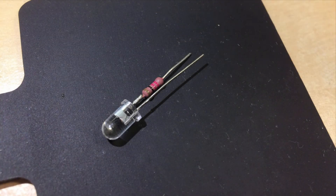This shows the LED assemblies that I used for the RPM trimmer illumination. This is just a high brightness red LED and a current limiting resistor. It still shows a 1K resistor here, but it turned out it was too bright, so what I really put in was 3.3K resistors.